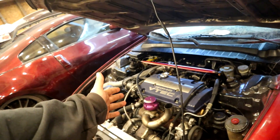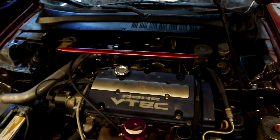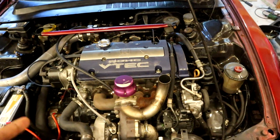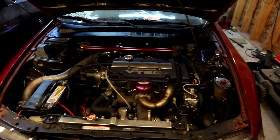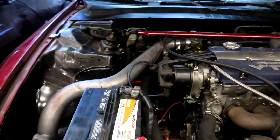Another reason I think it's a sensor is because it's super cheap — it was like a dragon gauge, like 20 bucks for the gauge and sensor. Aside from the head, that's the only other thing that carried onto this build, so nothing in the block should be giving it low oil pressure, especially because it has a new oil pump. That's pretty much what I want to do today.